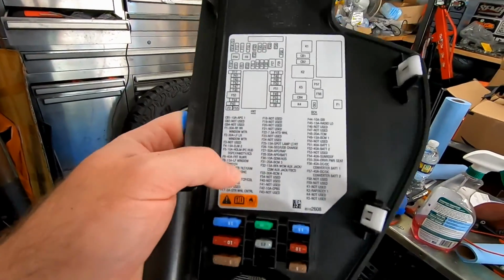And what we need to do is add 3 pins to pin number 3, 11, and 13. Those 3 pins are not present on our truck because it's just the way they were wired from the factory. And what you're going to do is run those 3 wires to any 12-volt switched ignition source. So basically, what William did, the guy that actually did the swap in the first place, ran all three of them over to the passenger side fuse panel.